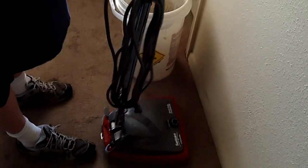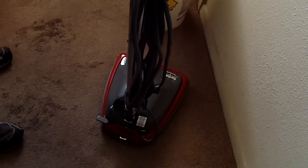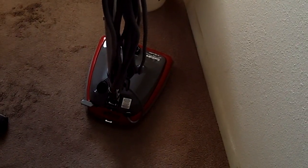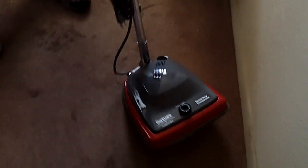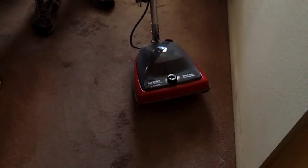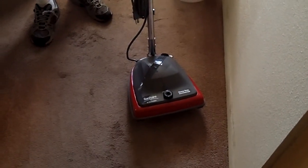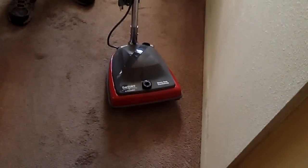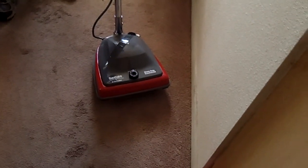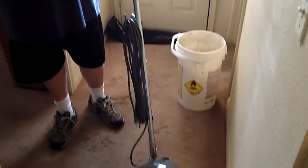Alright, and there's how it works. And then the bag, we haven't put the bag back together, but all you've got to do is fix it at the bottom, and then bring the spring up and pop it into this little hinge, and you're ready to go again. And I showed this on video, so it took a while because I was explaining it, but you can actually clean the bag in about 2 or 3 minutes, and you can take that whole bottom end apart. Once you know how to do it, you can take it all apart and clean it, put it back together in about 3 or 4 minutes, so it's no big hassle at all. Basically, that's all there is to that.